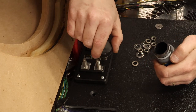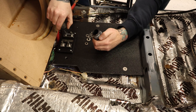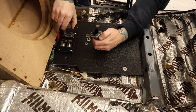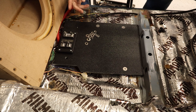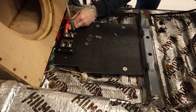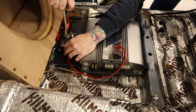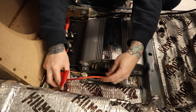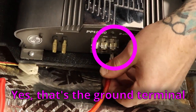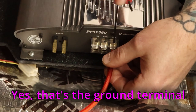I think all these posts are stainless steel, just the way all the hardware goes on and off, so I want to hit these with some anti-seize. This is graphite anti-seize — supposed to be the best. Do not get this stuff on your skin because it will absolutely stain you for days. Now that might seem like overkill, but if you thought cutting speaker holes out with a router was a terrible job, getting one of these things unstuck after the stainless steel is galled up beats it ten times. Torque to perfection. I've selected all the wiring sizes just based off what the amps can take — I'm not going to put any bigger wire into the amp than what it will actually accept.